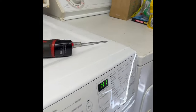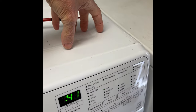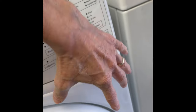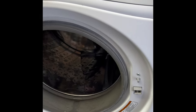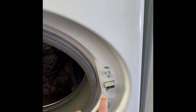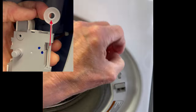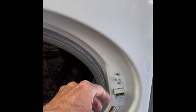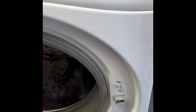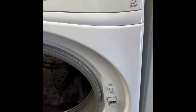Then all you have to do — it's really easy — is reach in right about here. You've got to go down pretty low with your arm inside the cabinet through an opening, and get your hand behind the door lock. Then you can pull up on a plastic piece — it's like a little release — and that will allow the door to open. It's also a reset for the computer that clears any errors.